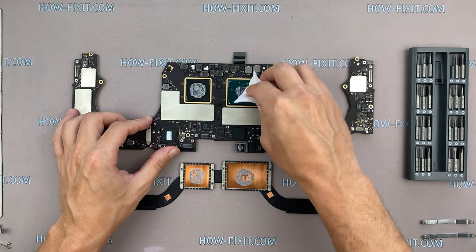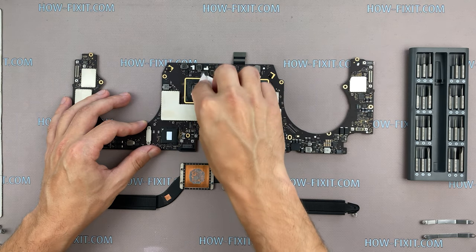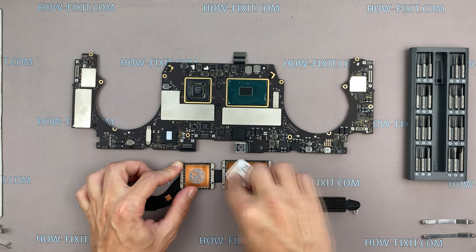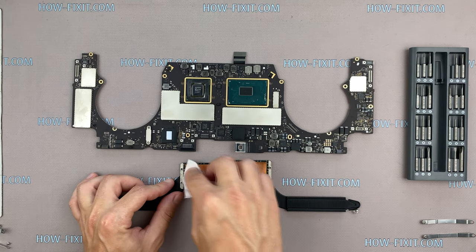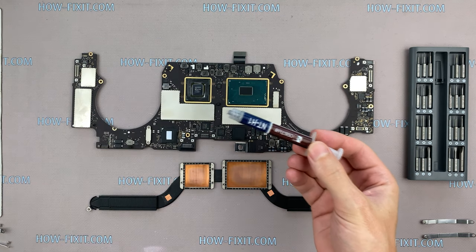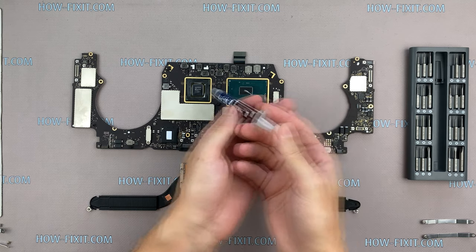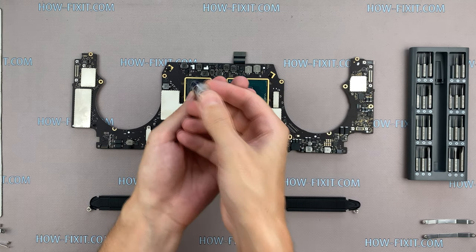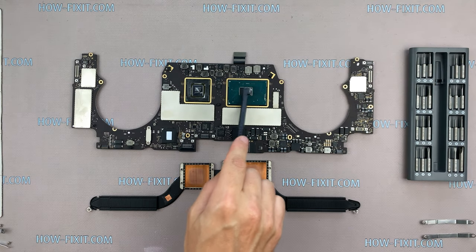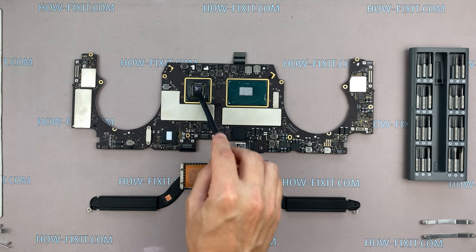Remove the old thermal grease from the CPU and GPU, as well as from the surface of the radiator. Now take thermal paste and apply it to the CPU and GPU. If you still don't know which thermal grease to choose, in the description I left a link to a test of the best thermal grease for laptops. Spread thermal grease evenly over the entire surface.